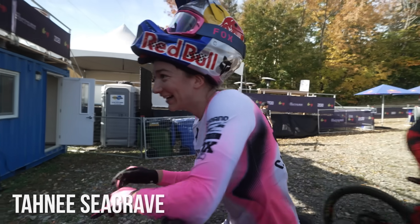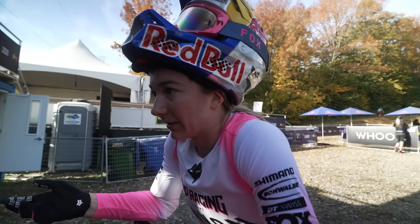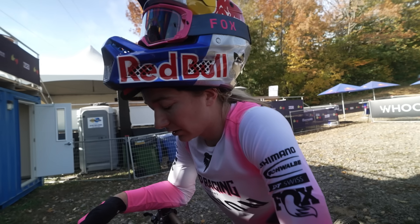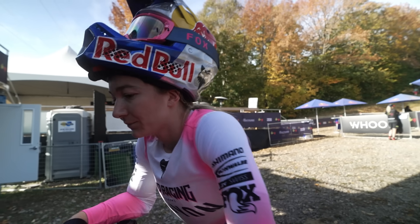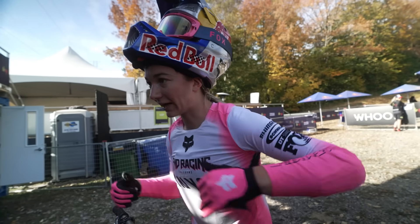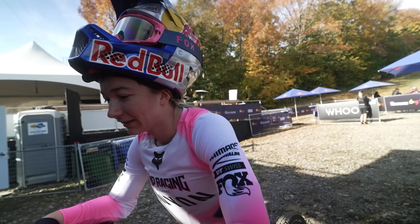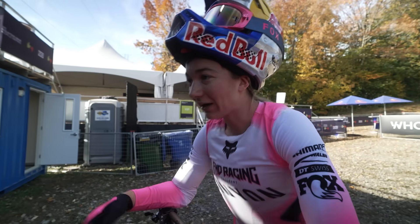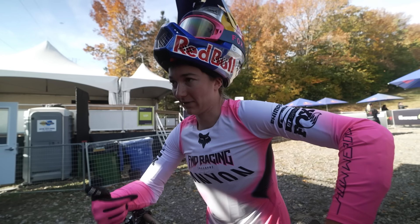I went against what you said, only because I really wanted to load the front more, and I felt because I've only got one run left before my qualies. What we did is put the low speed rebound back to where it was before, and took some air out to see what that felt like. Although I feel like I'm able to attack a lot more and I do like it, it does feel very soft at times. Maybe what I should do is let air out and now make the rebound faster again.